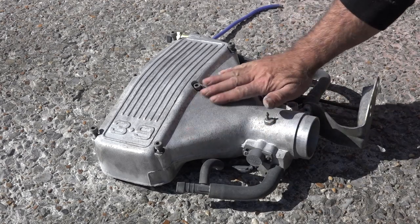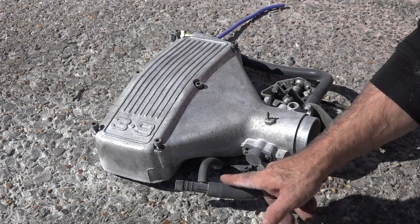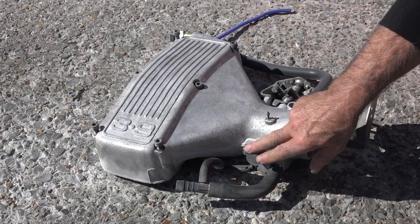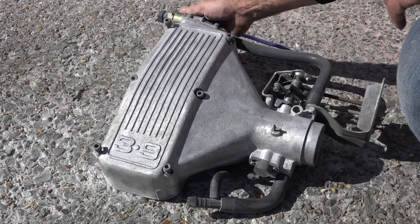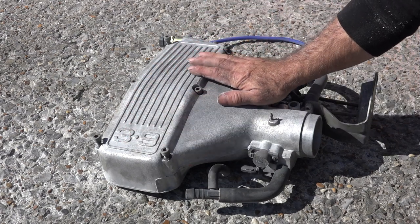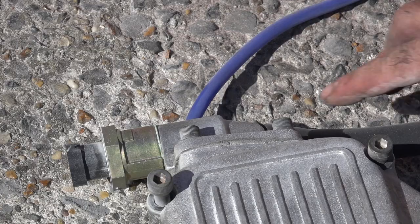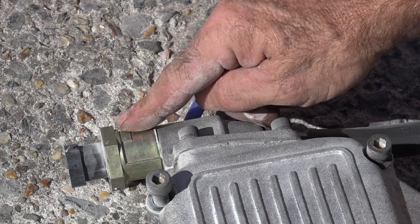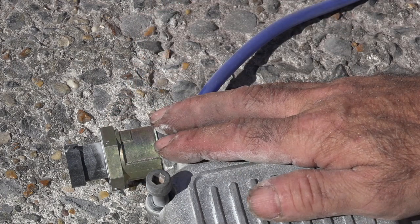And you saw me blasting real quick, so this is the final result, but of course I didn't spend a lot of time on it. You all saw me blasting on the plastic here, and you see there's no damage on that plastic whatsoever. I also blasted on the copper, I don't know if you can see that, and that didn't get any damage. So if I was to do this with garnet, that would be a completely different effect. So that's the good thing about soda blasting. Even here on the hose, you see no damage, and the copper piece has no damage. It's just cleaned up very nicely. So that's the good thing with soda. It is not aggressive whatsoever.